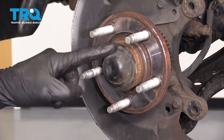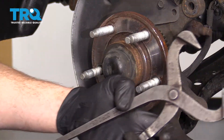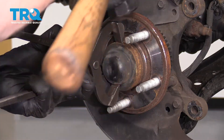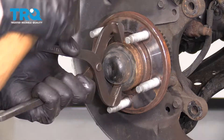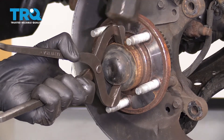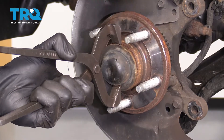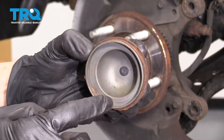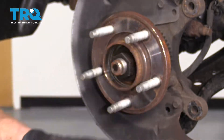At this point, we can see the cover right here. Using this tool, which has some little edges on it, come right along the edge where the cap meets onto the hub and grab onto it right there. Give it a little bonk and it breaks free. You want to check your cap to make sure there's no damage that might let moisture in. This looks great — set it aside.